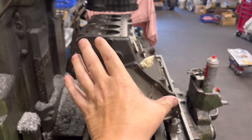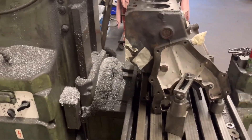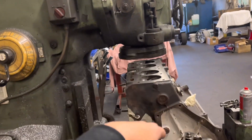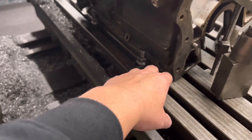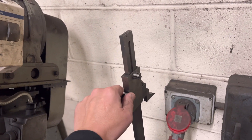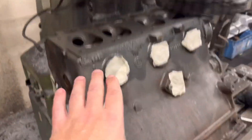So what we've had to do is tilt the block over to get the block face at the right angle so we can reface it. Fortunately the maximum height we've got on this machine between the bed and the cutter is 16 and a half inches, and very fortunately from there to the surface is 16, so we've only got half an inch to spare. What we do with a block like this — or a head like this — is we've got a flat edge on the back, having removed the studs for the sump, and we've got a flat edge on the back to sit it onto the bed. We then put our little jacks under the front and use our height gauge — this one here — which has got an adjustable head up and down. We basically sit the height gauge on the bed and just touch it on each corner of each side until we get it level.